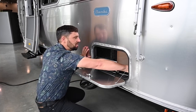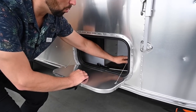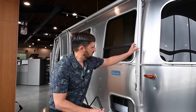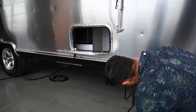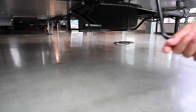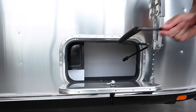There's a light inside the compartment to illuminate it so you can see at night. In here are tools, including a tool for your stabilizer jacks. All four corners of this trailer have stabilizer jacks — they're not meant to level the trailer, but to stabilize it so you don't get that rock and roll when walking around inside. You stick your tool on the end and jack it down. We sell tools in our parts department that you can hook to a cordless drill. Get them down to the ground, do about a quarter turn, and that will take the bounce out of your walk.